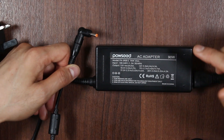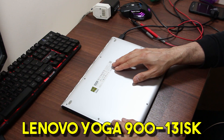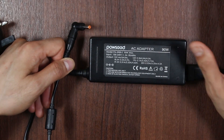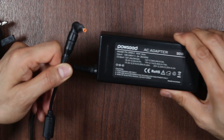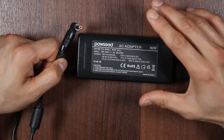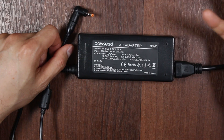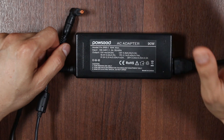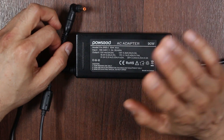In the previous video — which was also another Lenovo one — we had an issue and I explained it, you can watch the video. There were potential problems with the charger, but we could not get the right charger to finish the tests. And that goes to show: just because you've got DC voltage does not mean you have the right amp. Never assume, always test. If you can, get a borrowed charger from a friend to test, but don't make conclusions just because you think the laptop charger has DC voltage — it is not always conclusive.